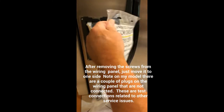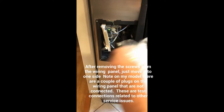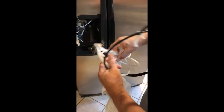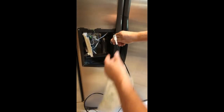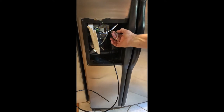So here's the new part. It comes with two pieces of hose. I think we only need one. This is the hose that goes from the ice maker to the back of the refrigerator. This is the hose we need — it runs down the door and connects at the bottom. Here's the little outlet that goes there.